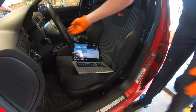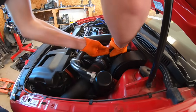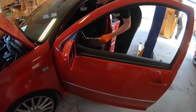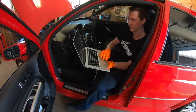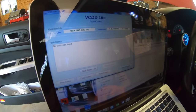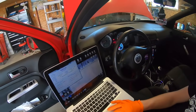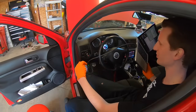I saw his MAF was plugged in. This is a MAF-less tune, so we're simply going to unplug the MAF. There you go. I'll show you when we start this up — there'll be no MAF code. Going to check the fault codes as soon as it loads up. No fault codes. There you go. Alright, so we're going to go out for our base run. We're going to see the fuel trims and check over the data. Now it's time to go enjoy it!